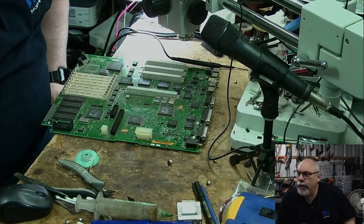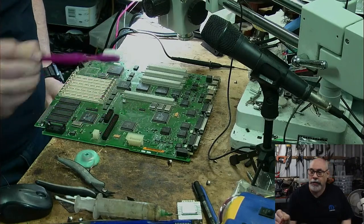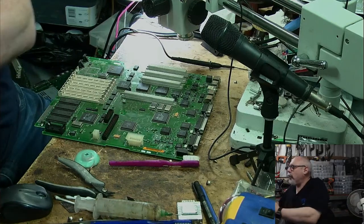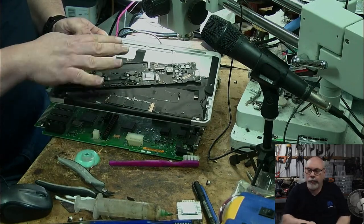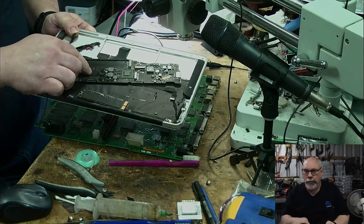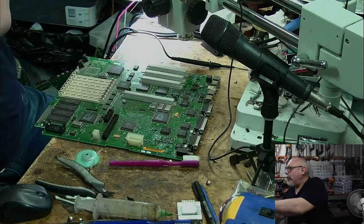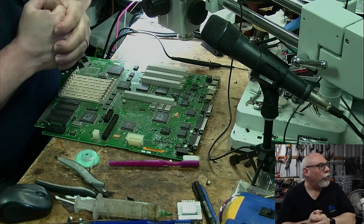Okay. How do you clean heat sinks? No, I'm saying the wrong thing. I'm not actually using it for cleaning heat sinks. I've written heat sink on there, but I use it for cleaning the chips after removing the heat sink. I don't have an example here. Or do I? Maybe. If I'm working on a board like this, there's a MacBook Air. If I'm working on a board like this, when I take that heatsink off, it leaves behind the thermal compound. It's the grey stuff, and it goes all kind of chalky and powdery after it's old, with the stuff that Apple use. And when I clean that off, because it's sort of all powdery, it gets everywhere. And so that's why I have a specific toothbrush for that. So it's cleaning the thermal compound off the chips after the heatsink is removed. That makes more sense than what I said initially.